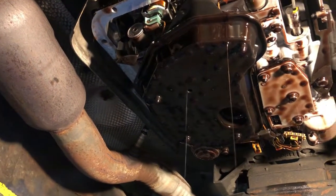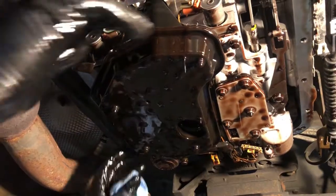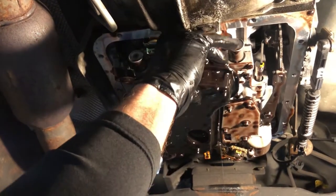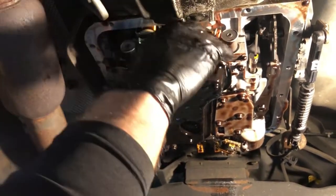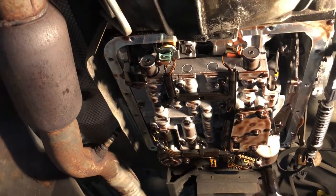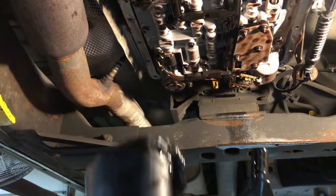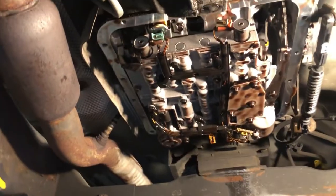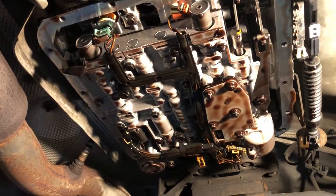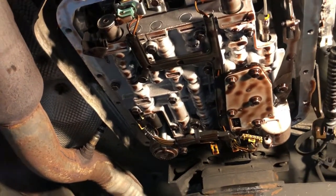It's not necessary to pull the filter off if you don't want to change your filter or don't have the money to. But if you do, make sure that you pull straight down on this filter. You don't want to pry on it too much. Just work it down out of there. I've seen people break this neck off up in that pump and that's hard to get out — you don't want any piece of that getting into your pump.